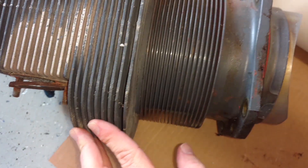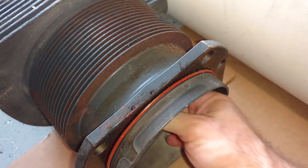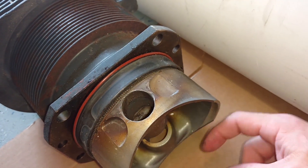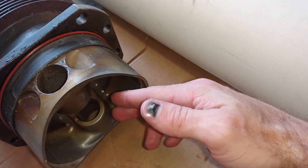Plus there's friction from having this piston ride up and down inside the cylinder. Normally the piston rides up and down, and then you have a connecting rod that would come through here. You have a wrist pin that goes through there connecting your connecting rod, which comes out and connects to your crankshaft.